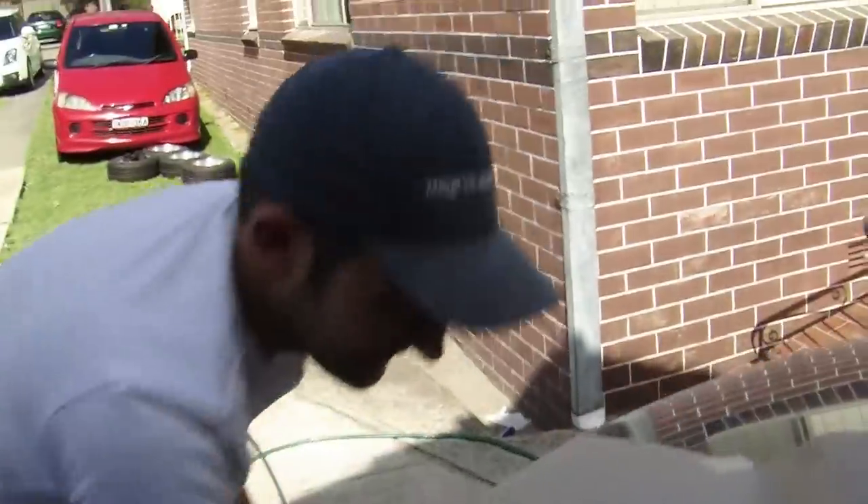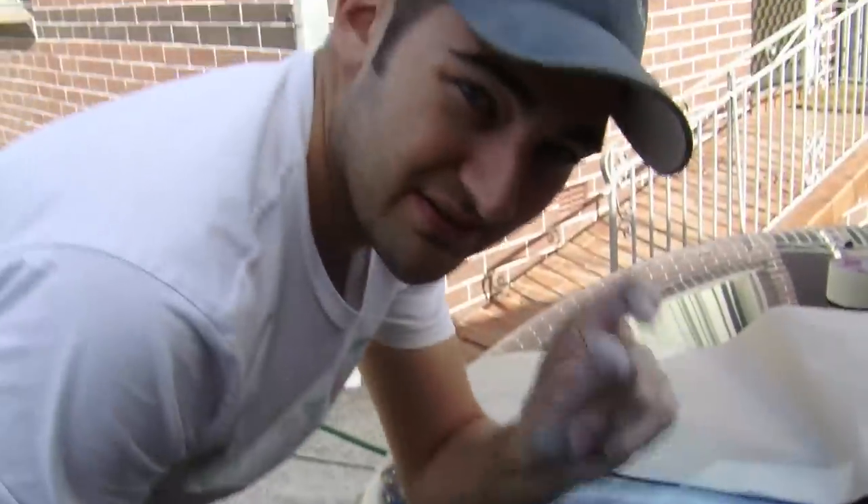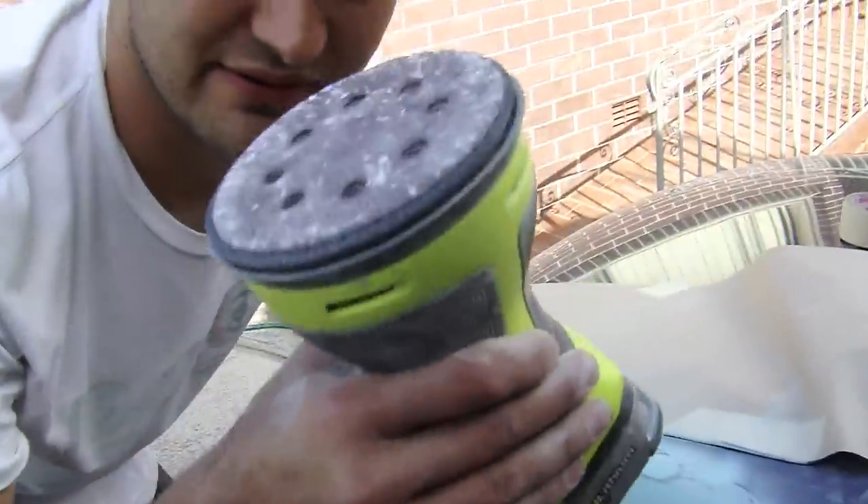The thing is with this panel repair - everything has to be smooth. As soon as it looks or feels a little bit textured or not quite right, it's going to show up on paint, because paint is so super thin that it shows up every single imperfection. That means going back - sanding, painting, sanding, painting, priming - doing it over and over again. Everyone always goes on about prep, and it's true. Even though painting is the fun bit, this is the important stuff.